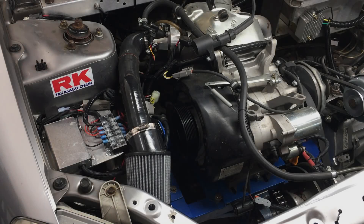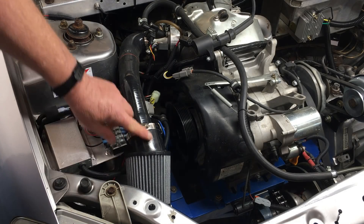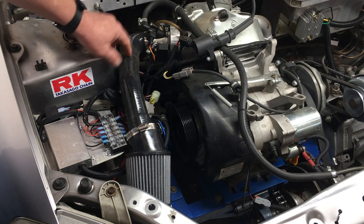There could be several reasons the sensor is reading low. The simplest reason is there's a restriction or obstruction in the intake tube, or a clogged air filter. So let's take a look — of course we're going to need some tools.